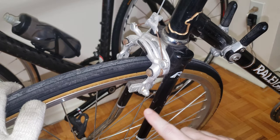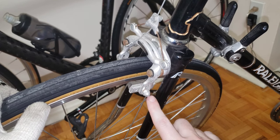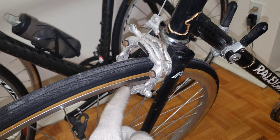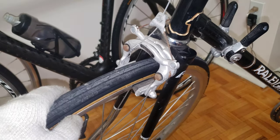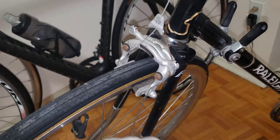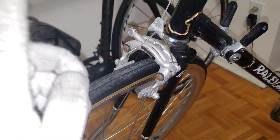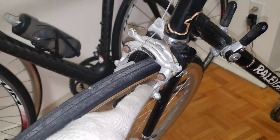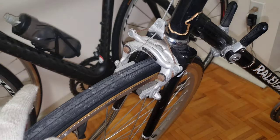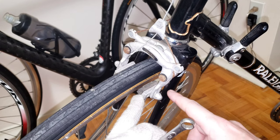The second issue you may have with the pads is if they start biting at the back — they'll make contact with the wheel at the back and will be noisy. What you want is for the pads to bite equally, or bite first with the front side. If you zoom in, you can see they do bite slightly from the front, so the wheel won't create that counter contact which produces brake pad noise. The same applies to the pad on the other side as well.